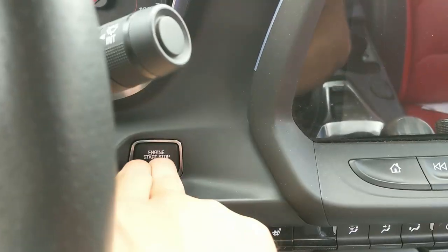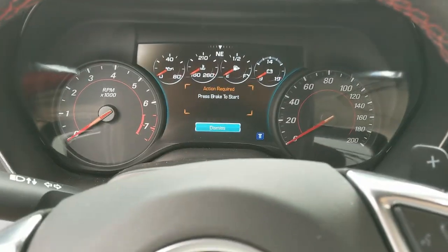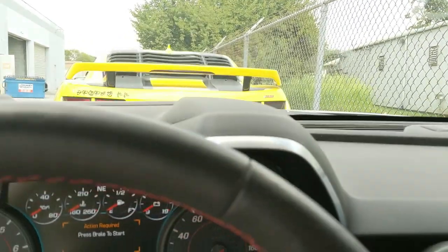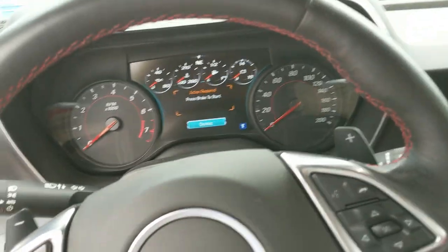Next up, so you got your log file, you got some data, now it's time to tune. With HP Tuners plugged in, some cars, again, will need the internet, some might not. You're going to do the following steps. Not starting it, keying on. So accessory mode is usually good. Sometimes you'll press and hold in order to go all the way on without turning your engine on.